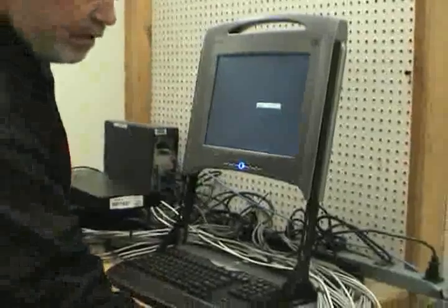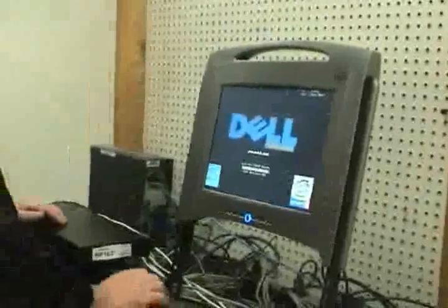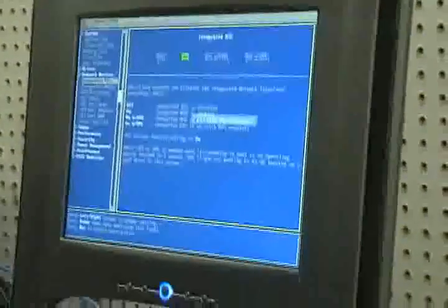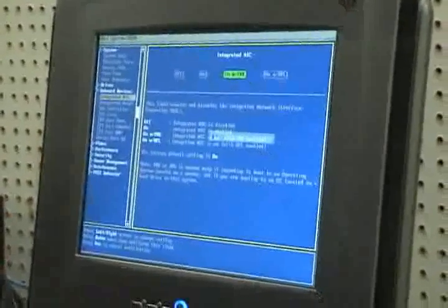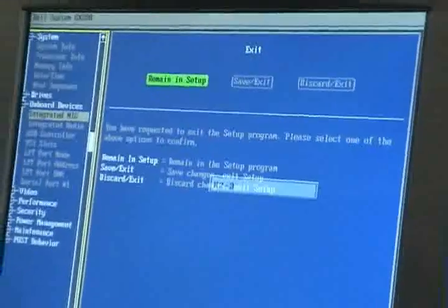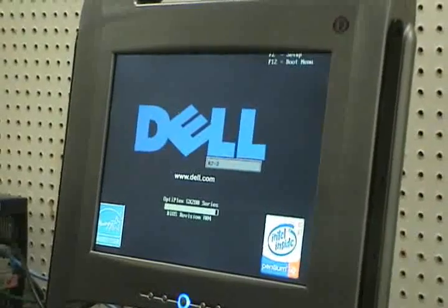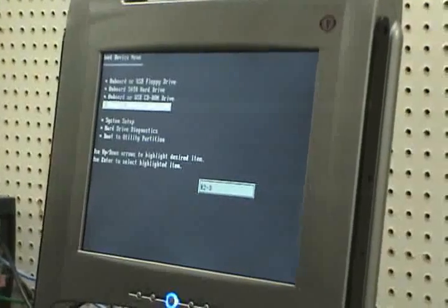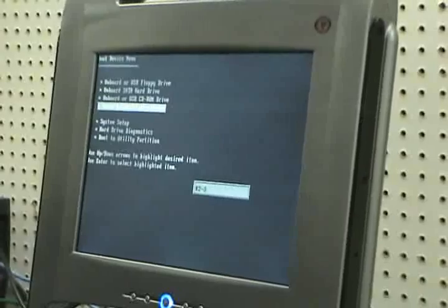Right now I'm going to turn this on. We're on the third system here — we'll hit F2 to go into setup. When we get in, we want to go down and select our network devices. Depending on which manufacturer you're using, there will be different setup steps. So right now I'm going to select PXE on, escape, save that, and then reboot with F12 to go into the boot sequence. Go down to the onboard network controller, select that, and we're off.